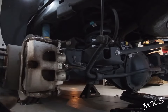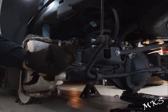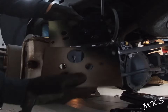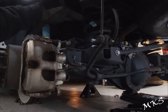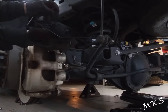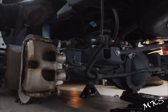We've got the jounce bumps off. Now we're going to take the button head screws that they supply — they're a little longer ones and you should have four of them. It doesn't matter which plate you use because they're both cut exactly the same, so you just flip one over to the other side. This is going to go just like so, and then you put these back up in there to secure the plate in place through these holes. There's a slotted hole and a regular hole. These are going to get torqued to 30 foot-pounds.